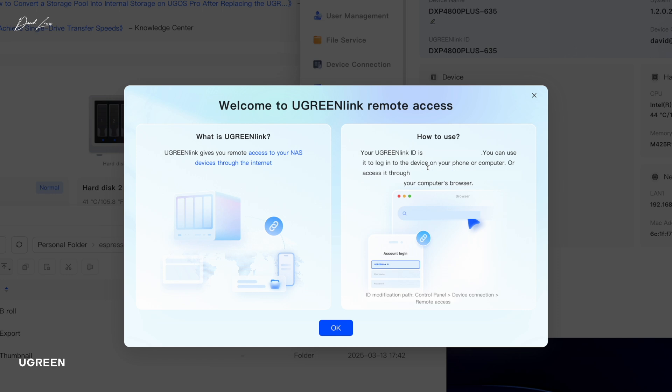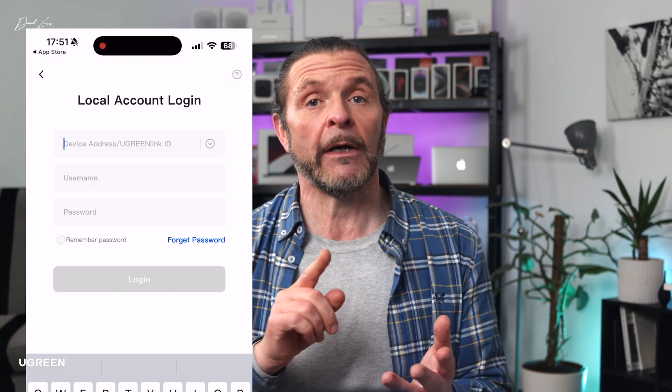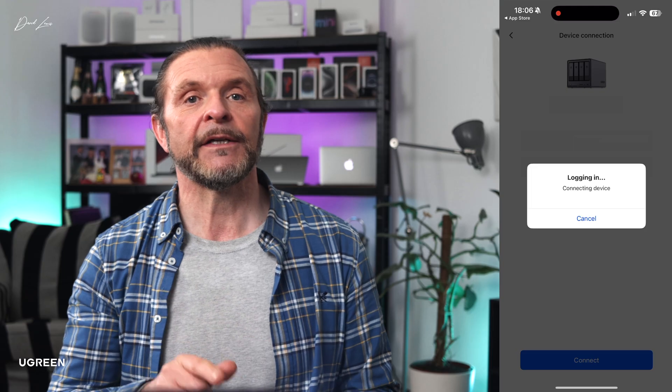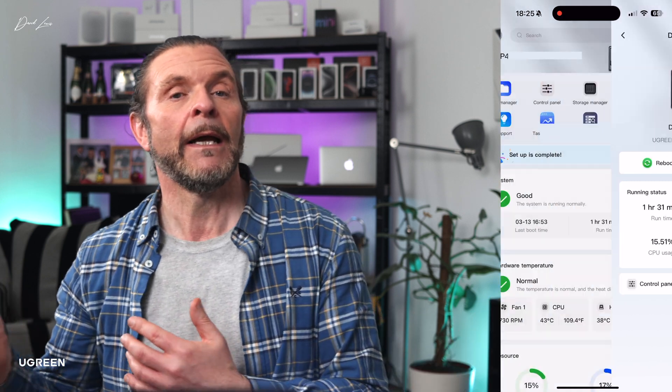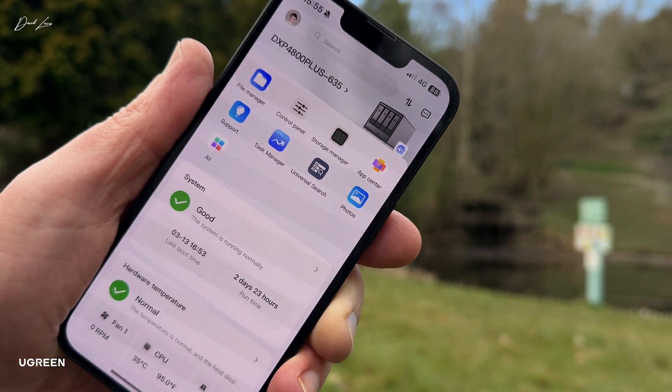At the bottom of the setup screen, click on Remote Access. There you'll find the addresses you'll need to access your NAS from anywhere, which I kept a note of in my password app. I also downloaded the Ugreen NAS app to my iPhone 16e, iPhone 16 Pro Max, iPad Mini, and iPad Pro. Log in with the existing account option and enter your unique Ugreen link, username, and password, and then you can access your files from your phones and iPads. From another Mac, you can access your NAS by typing in ug.link followed by your personal Ugreen link. For speed, I've saved that Ugreen portal to my Safari favorites for quick access.